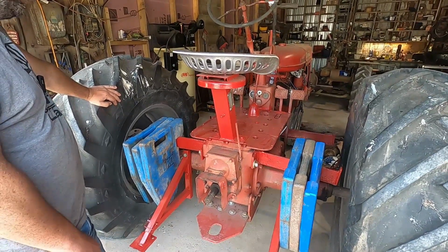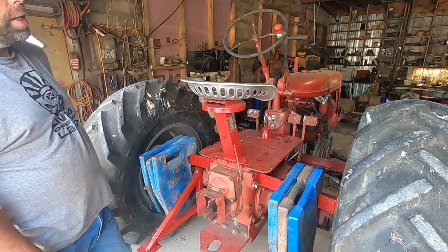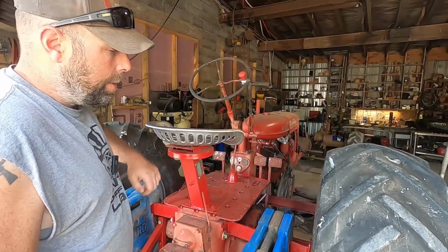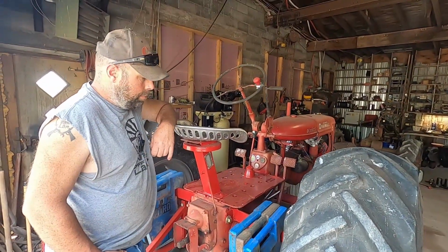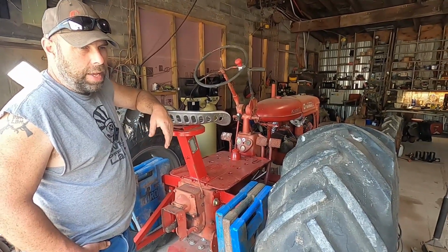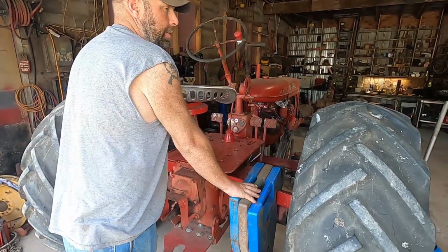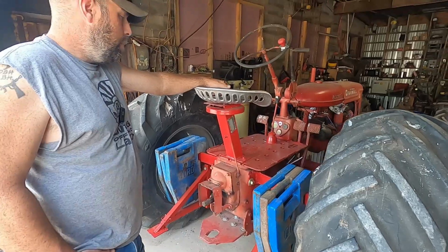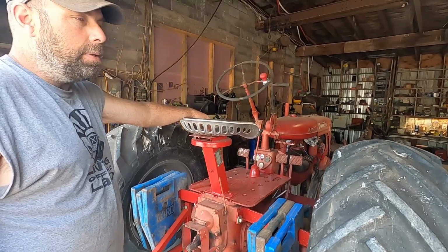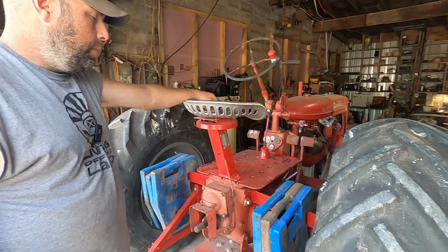Getting really close. Still trying to find a set of front tires for the front end so we can change them out to a lighter front wheel and tire, which would help because that would shave a little weight up front that we can put in the back as well. A lot of the weight savings seems kind of weird because we're shaving weight off, but we're gonna have to add a bunch of weight in. But we're shaving weight off the front and middle that we can put right over the axles, which in the later classes, we'll be starting out with weight right over the axle that we weren't before, which will give us a better bite, and maybe we can do even better in the lower classes. So it gives us a better fighting chance. Yep, I guess that's it.